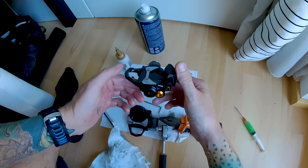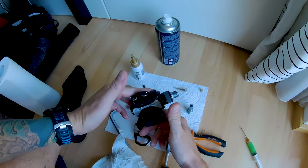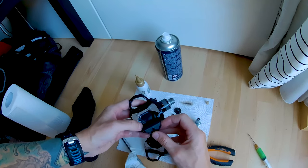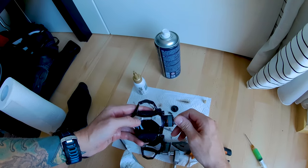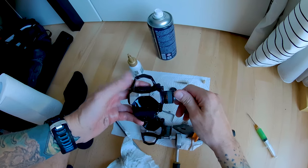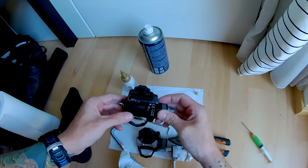Clipping in is one of those skills you can acquire after some training. What I do like is that the clamps are adjustable — I like the stiffness and the adjustability, the range is quite good. I'm not really a fan of the Look Keo cleats; coming from Shimano I had to buy the zero-degree float, otherwise it was just way too much float for my taste. So if you're coming from Shimano, maybe you should order the black or gray cleats with zero percent float, and then I think they are quite usable.